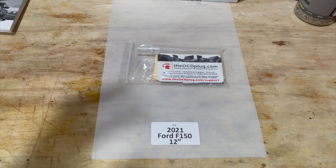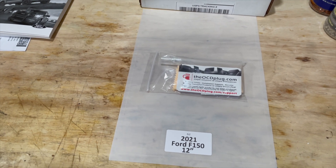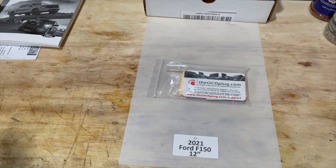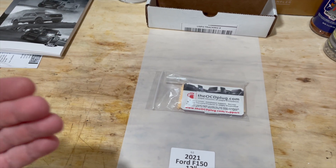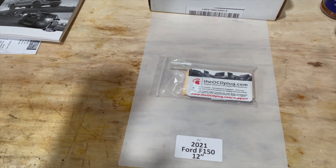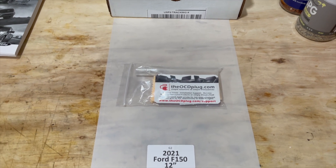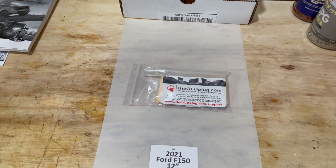It really couldn't be easier. It's going to take a couple days for the bubbles to totally evaporate, but you can speed that up if you're brave and very careful with a hair dryer. Please don't use a heat gun because it's too easy to go out of whack and ruin your display. With a hair dryer, just get it barely warm — it does not need to be hot.